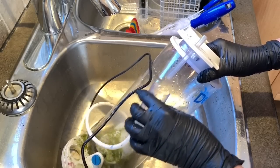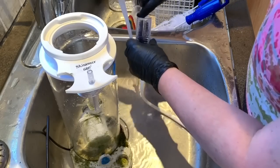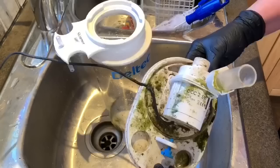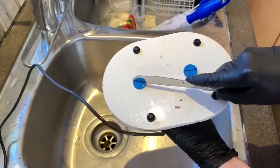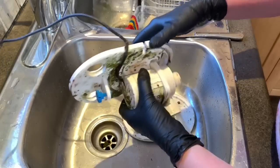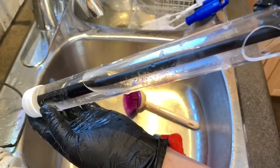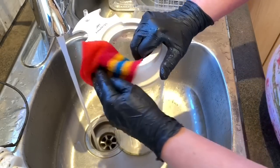The air intake was pretty easy to remove because it's just a friction fit and I was easily able to remove the hose from the Venturi — cleaned that all up. Next, I had to remove the skimmer body from the bottom plate, so this screw had to come out. Once that was off, I could see how really dirty it was. The bottom plate is made up of two layers with a space between — water flows between those layers as part of the functionality of the skimmer, and yes, it was dirty in there too. It was easy to slide the pump off the little track and get this thing scrubbed up. Back to the tube with the vinegar — most of it had leaked out, but it was quite easy to get the rest cleaned up because the soaking did loosen things.